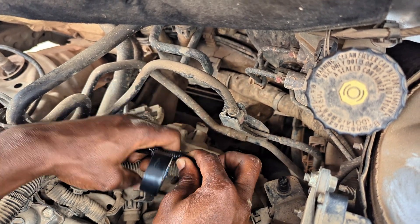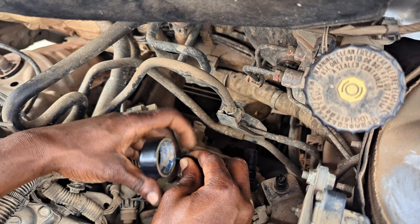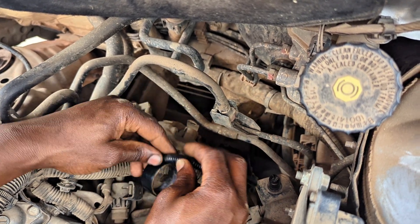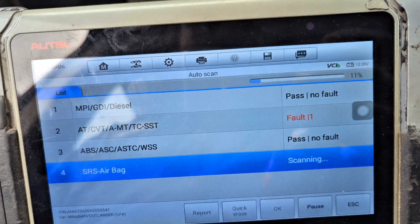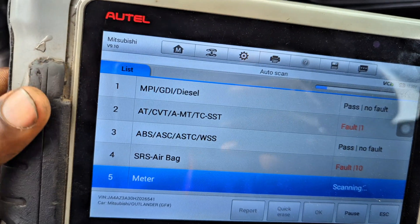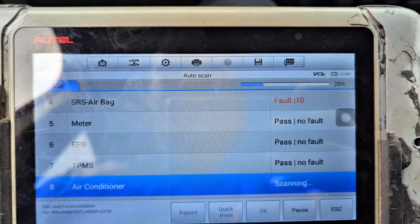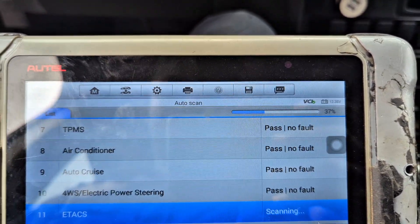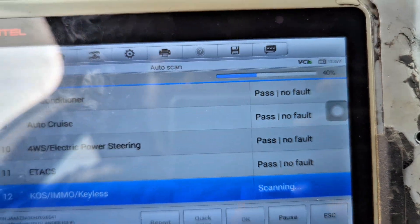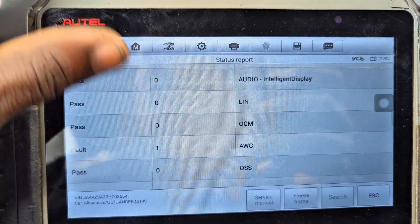Adding some more tape to hold the conduit or wire loom in place — that's done. I'll fix the sensor back in, then scan the car again. As expected, we still have one code in the system — the same code. Going to the report, the status of the transmission code should now change to 'stored' since we have a proper sensor and proper connector. We still have a code in the all-wheel control system (AWC), but the transmission code should be taken care of.